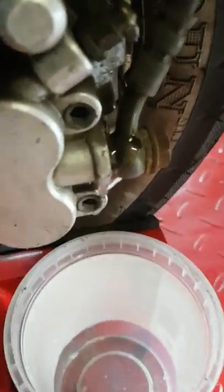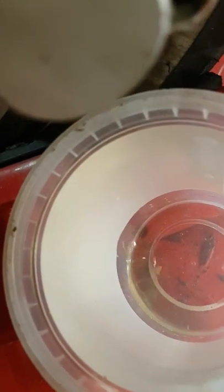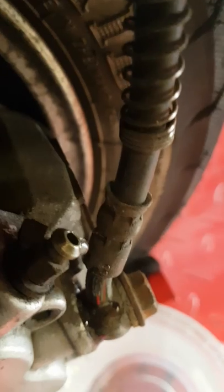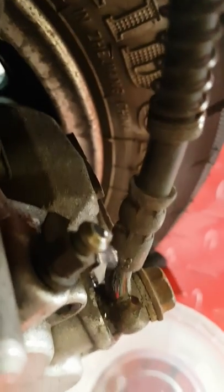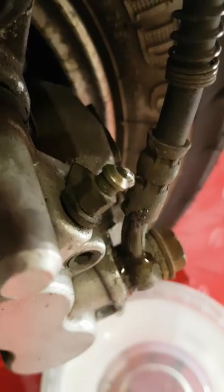What we're looking for is a change in colour. You can see that the fluid is white and clear — what I'm looking for is a change. You can see bubbles coming through because of the newer fluid forcing its way down, gravity fed. I need to get back up to the reservoir. I can just see the colour starting to change now — that would have pushed all the old fluid through. The only bit left will be where the piston is. So I'm going to nip that up, then use my finger to tighten it and go back up to the top. We don't want the reservoir to empty out.